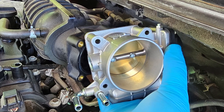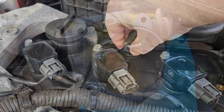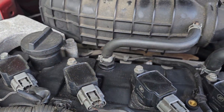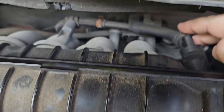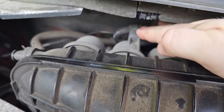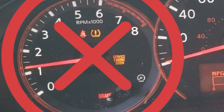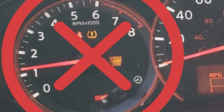If you've tried this correctly a few times and it's still not working, check your throttle body to make sure it's fully closed. Also check your PCV valve to make sure that's working properly, and check downstream of the throttle body for any kind of vacuum leaks, including the intake manifold and any vacuum hoses back there. If the engine stalls or the idle hunts, perform this procedure again.